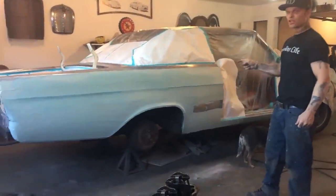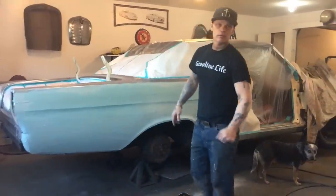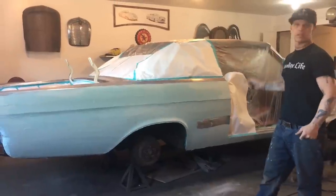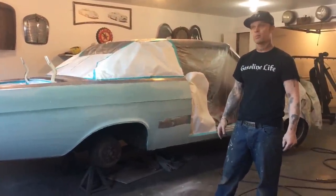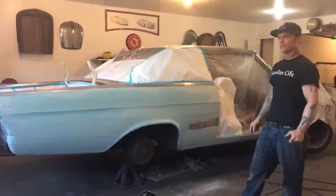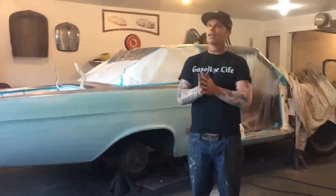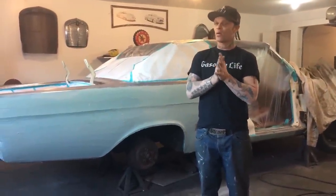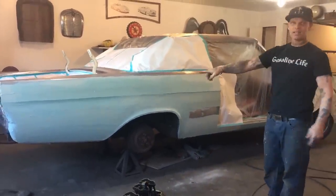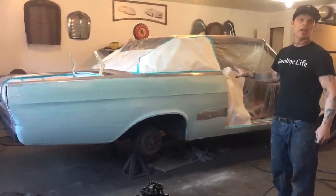The quarter panel's all filled up, just like I said — from there to there. I already know that has to be done to make that quarter panel look perfect. If you think you only have to fill this spot and then that spot, I'm past that — I've already figured out that I've got to sand the whole panel. I haven't sanded it yet; all I did is bake a cake on the side of it. When I hit metal, I have to stop.